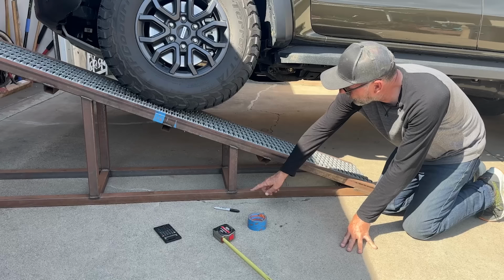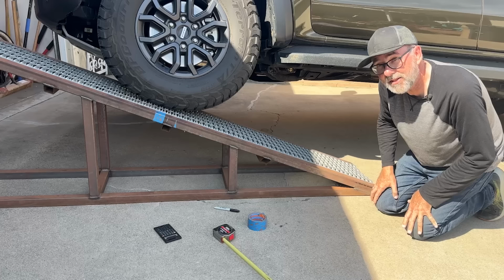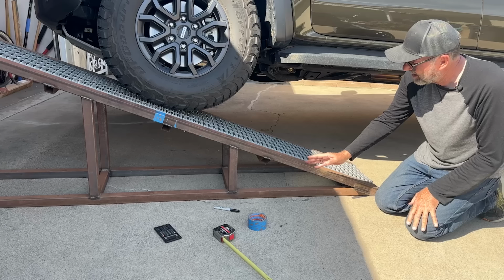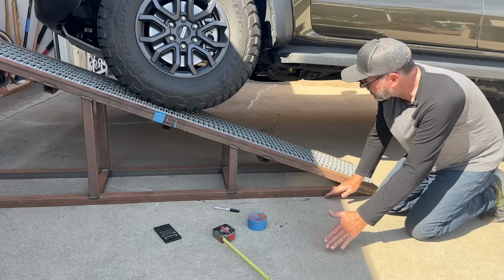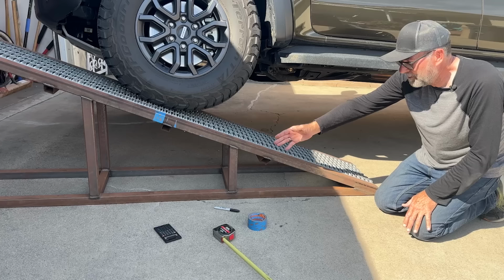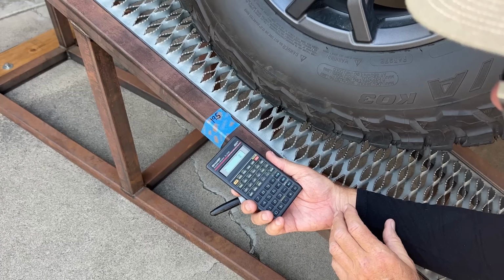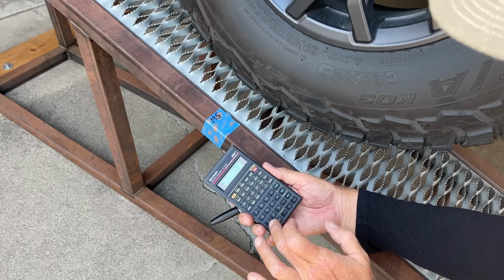And of course, the right triangle that represents the bottom and vertical legs here means that you can apply sine when you're dealing with the length that is opposite the angle that you've chosen to look at, and cosine when you're dealing with the one that's close to the angle you're dealing with. So I like to think sine up, and cosine close. So anyway, this height divided by the sine of 20 will give me the length along the hypotenuse that I really want. So what we've got here is 19.5, the measured height, divided by the sine of 20 degrees, and I get 57.01 as the climb distance.